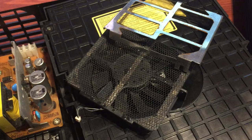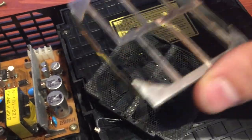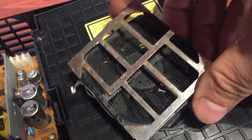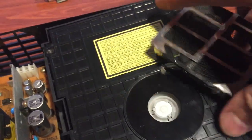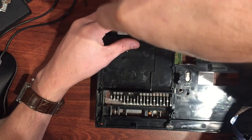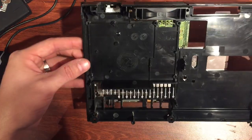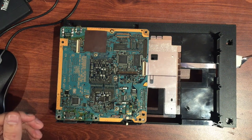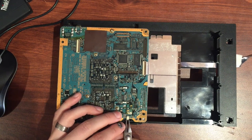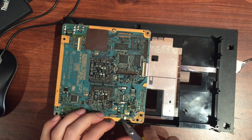I'm just adding this part of the video because I actually forgot to put the metal shielding back on the fan before I reinserted it — so don't do what I did. That just clips on here: put it underneath that cable and it sits on and clips on. Get that all done, then drop the fan in place. Grab one of the brassy screws and put that on the left side for now. Flip the whole thing over. With this flipped over, you can see the little fan connector — grab some pliers and put that back in, making sure it seats nicely. Tuck in those wires so something doesn't clamp down on them.